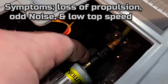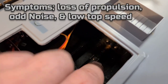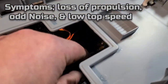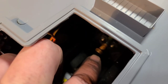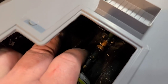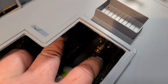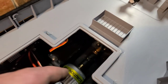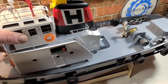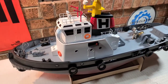At the end of our trip, the boat was making a noise and it slowed down quite a bit, started making a little chatter. I think I've narrowed it down to this universal joint. You can see that brass piece on the universal joint — it's not spinning with the universal joint. It's got a set screw there, so it's either missing a grub screw or something else could be going on. We're gonna check it out. Big B here with Ironclad RC — I like little boats and I just can't lie.